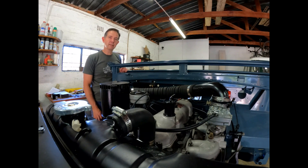The two main reasons why this engine conversion is so common and works so well: first, this is the closest engine to the two-liter engine that was originally in the Series One - the Series Two came out with a two-and-a-quarter-liter engine just a couple of years after the Series One, so from an authenticity point of view it maintains a lot of that authenticity. Secondly, this engine was produced for a very long time in Land Rovers, it's easily one of the most common engines, very reliable, parts are easily available, and it is very easy to look after.